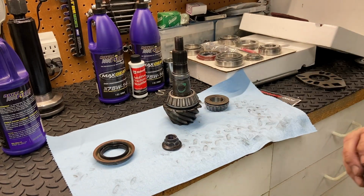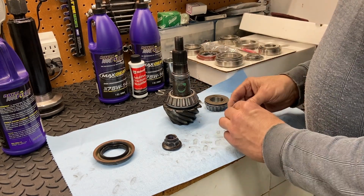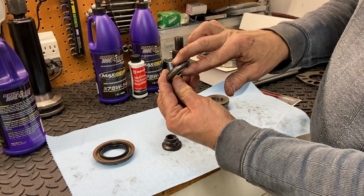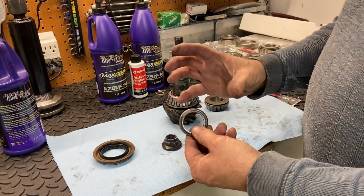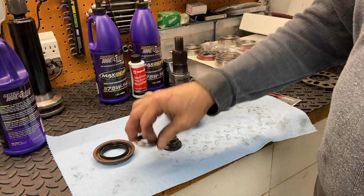One other quick note: if you did decide to go with a solid spacer, the way to attack it, I think, would be to take the old crush ring off and then measure the thickness of it, and then find some shims that would go along with the spacer, so it would be equivalent to that. At least that would be a great starting point.